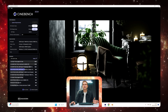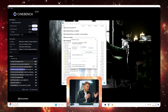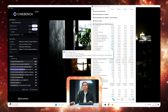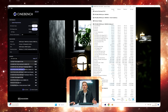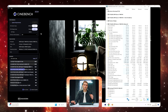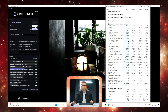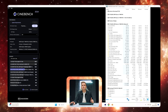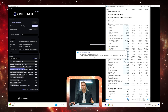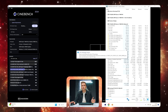Check this out — this is our mini PC. Opening Hardware Info, we can check the CPU package power draw. At idle, the CPU is pulling roughly 4–5 watts. I've already completed a Cinebench R24 test, but if I press the multi-core test and go back in, you can see the CPU package is at about 40, 41, 45 watts — roughly pulling about 45 watts.